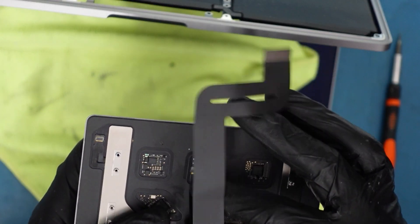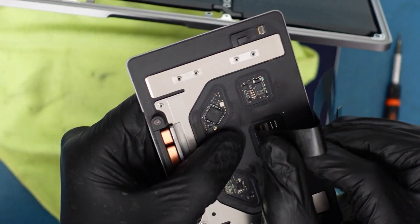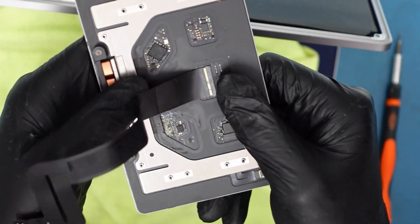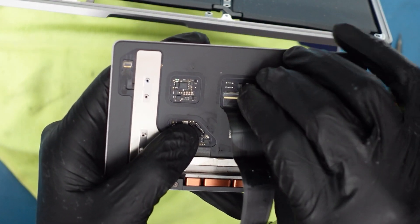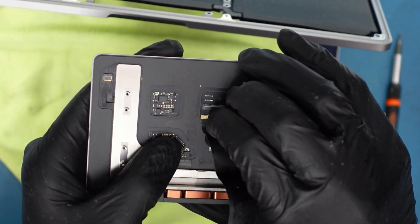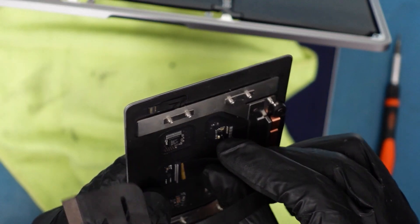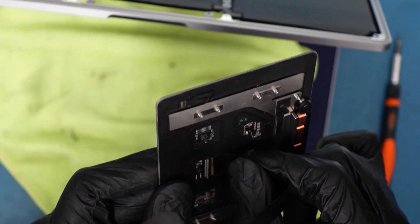Might as well get another cable too to put on. If you're doing just the trackpad, you would have to remove this cable. There's a little bit of adhesive on this side of the cable — we can lift this up a little bit. Then what we want to do is take the latch up here, and you can just use your fingernail. You see that lifted and this will slightly pull out, but there's still a little bit of adhesive there. If you put a little bit of heat, you can do that too. I'm just going to lift it a little bit and then pull it out very gently, and it comes out like that. So there's your sticky under here — it's a little bit of adhesive. If you're not sure if you had liquid damage, you definitely want to make sure that you put in another cable.